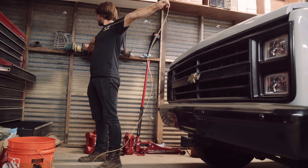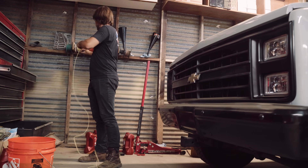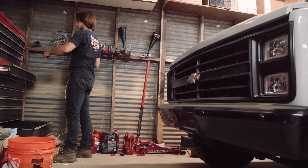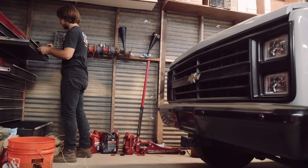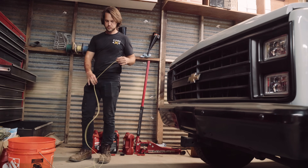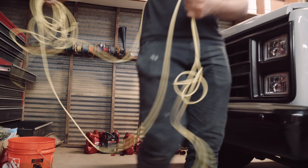When I'm doing an install in a vehicle that has an auxiliary power system, like in our van, then I like to have full-time power ability to the McTuning switch panel. On this build, I did need ACC switching abilities on other things, so I'll show you how I hooked up and ran an ACC-controlled wire now.